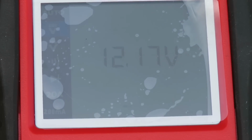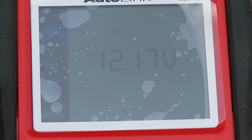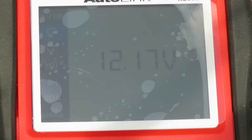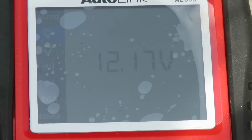Okay, guys, you can see it is 12.17. Okay, now I'm gonna take the key and I'm gonna start it up. And I want you to watch what this voltage drops to. Now remember, at its lowest point, 10.8. All right, so let's start it up, and you keep an eye on that. Key is right in the seat. Okay, here we go.